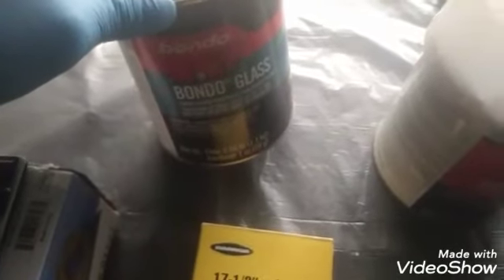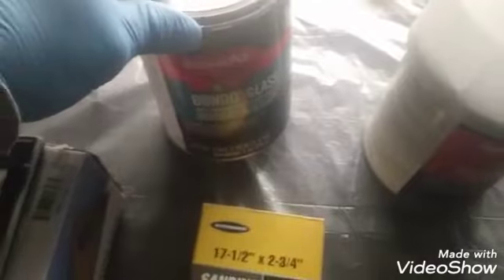Also another material for the work I'm doing on the quarter panel — we're going to require a little bondo filler for the pinholes only, not for structure. You can pick that up at Walmart for eight or nine dollars. And we got my favorite one which I use for 95% of my work: bondo glass, just to be waterproof — go figure if they use this on boats and boats float in the water. And of course you gotta have some handy dandy 5 mil gloves, you don't want to get your hands dirty. Four dollars. Under thirty dollars you get all this stuff and you'll be able to do so much on your car. These are essential — they have a home, so keep that in mind.